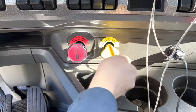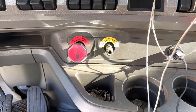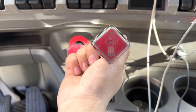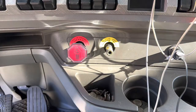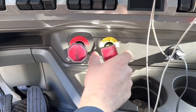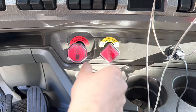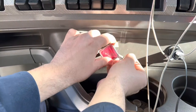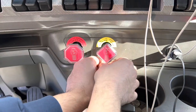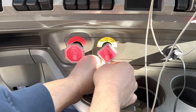Next one, we're just gonna unscrew counterclockwise until it comes out. We're gonna do the same thing. This is the new one — I got these from Rainey's. Here's your screw. Now you want to twist it clockwise so it stops and you straighten it out, right about there. Take your Allen hex key, position it, and tighten it down. You want these pretty tight, because you gotta remember you're gonna be in here pulling and pushing these buttons constantly.